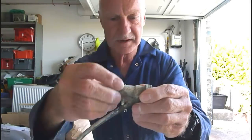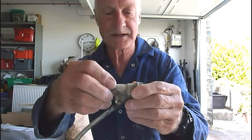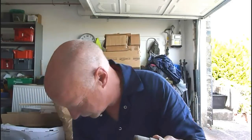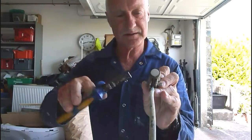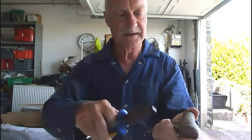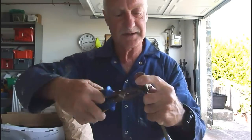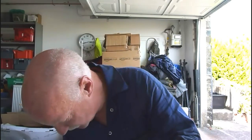Loosen this nut off — I've just cracked it with a pair of grips so it'll come off easily. Take that nut off there. Now pinch your circlip in — you can see it there — pinch it in and pull it out. Put your pliers on there and pull it through. It can be a little bit sticky; you can oil it if you want to make it a bit easier.